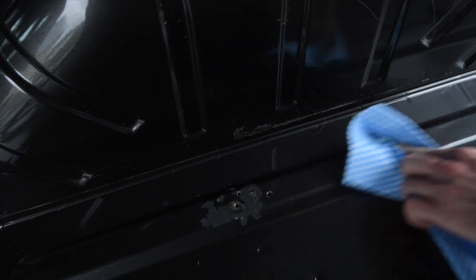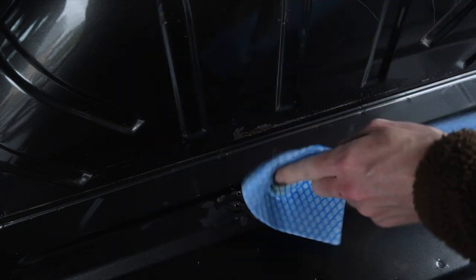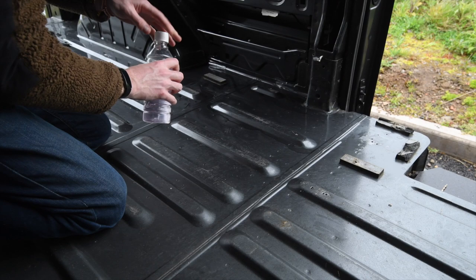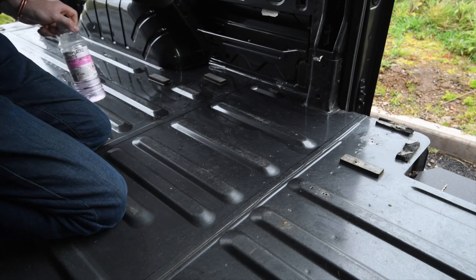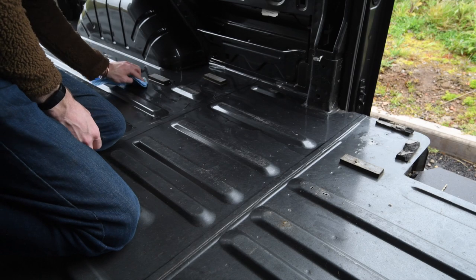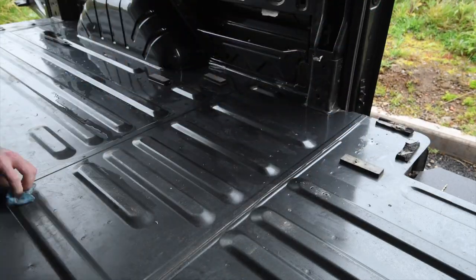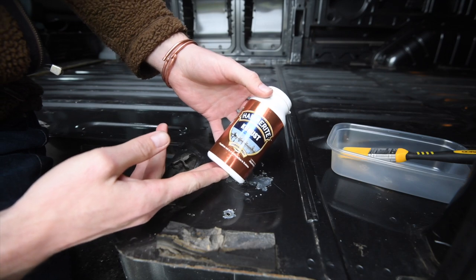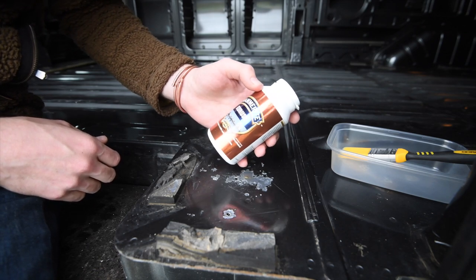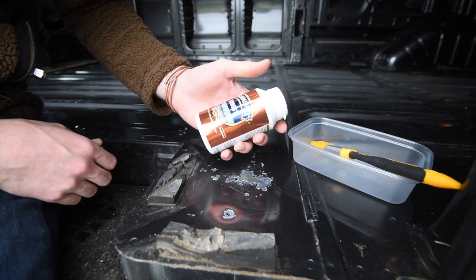Since I'm using a rust converter paint, it doesn't matter if I missed some spots where I should have been rubbing the rust away — the rust converter paint is going to stabilize that rust into something that won't continue to grow. As soon as I pressed stop recording I managed to knock over the entire bottle of methylated spirits all over the floor, so the van smells great right now, but at least I've got a nice reservoir to use. I'm going to shake the rust converter, pour it into a little container, and paint over those areas, making sure to get down deep into the old screw holes, then leave it to dry for a couple of hours.